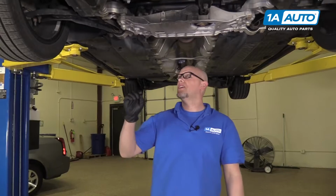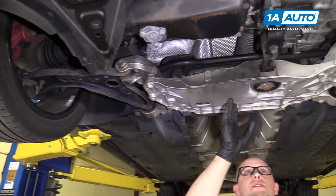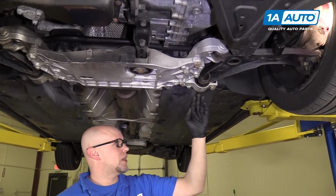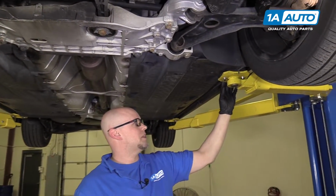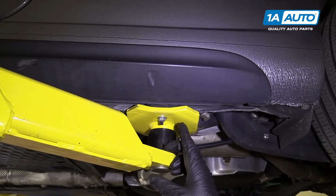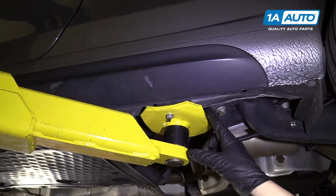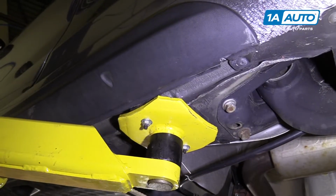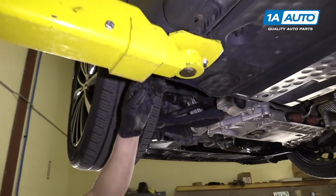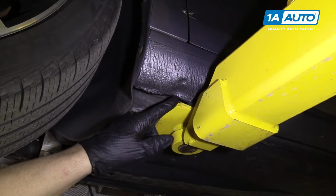Raising and jacking this vehicle, you're not going to want to use a jack or jack stands on the control arms or on this aluminum because you may break the aluminum. Some places you can jack up from is over here where the pinch weld is. On this Volkswagen, you can see there is specific spots where you're supposed to jack the vehicle or support the vehicle. These little arrows indicate that, and right on the pinch weld is the strongest part to be jacking and supporting. And same over here, this side. There's a little arrow pointing down. This one looks like it got smashed a little bit.